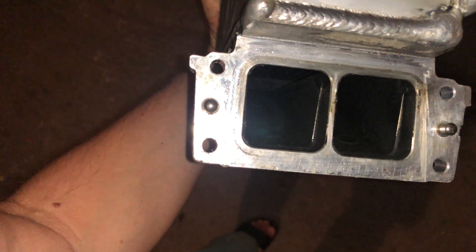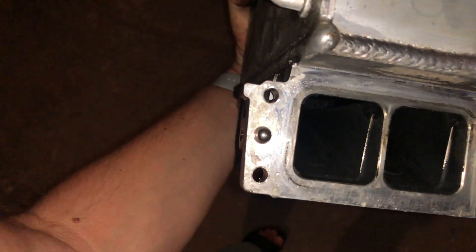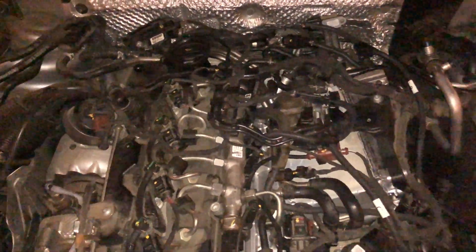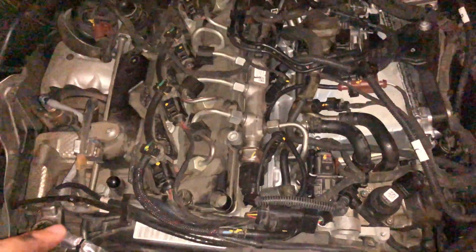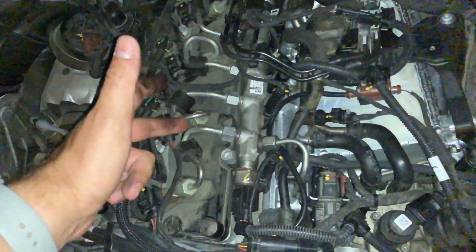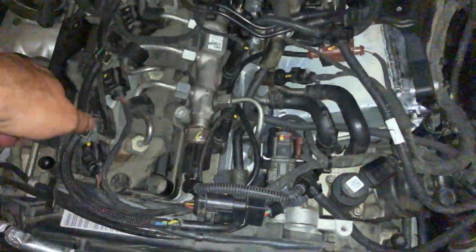I kept the part so I could also check what the EGR airways look like — everything was clean. The car is above 170,000 kilometers and everything is working fine, no blockages of ash. Now, something interesting: when you do the pressure test, if it's this part, most likely when you shut down the car two of the valves will be open and two will be closed. That's what happened here — the second and fourth cylinders were full with coolant, while the first and third had nothing.